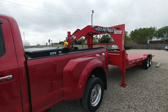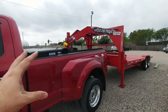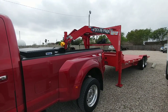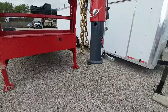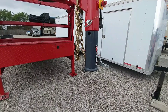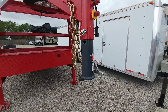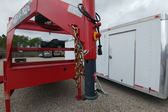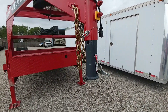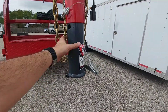I might try some other styles as well. This is the Bulldog system — I know there are other great couplers from companies like Gen-Y as well as Reese, but this is a pretty cool setup. I moved it up one notch and it should be perfectly level whenever hitched up. Just have to refasten my two set screws and get the locks back on, and we'll be ready to roll.